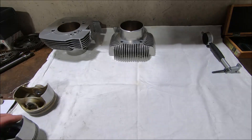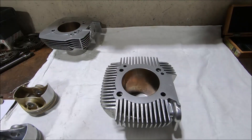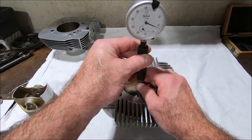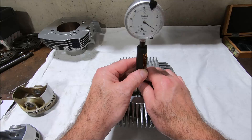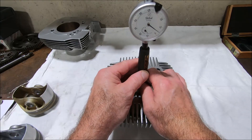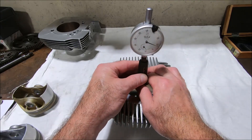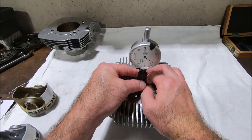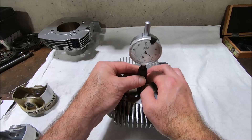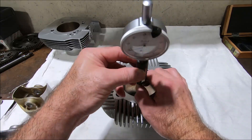This was for the B piston in the horizontal cylinder. We'll see what clearance we have. The spec for this is 0.025 to 0.045mm. On the cylinder here it is 0.04, down a bit 0.038, and down the bottom 0.03 or a touch over. So that one's fine.